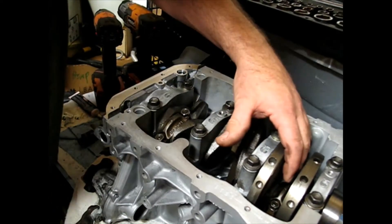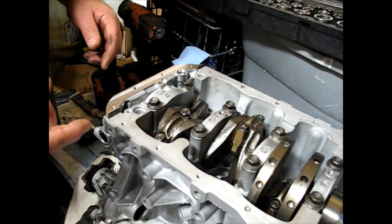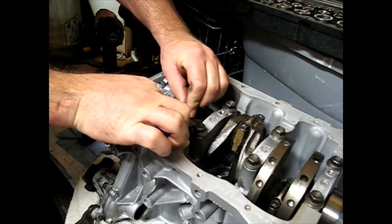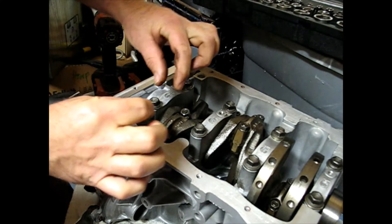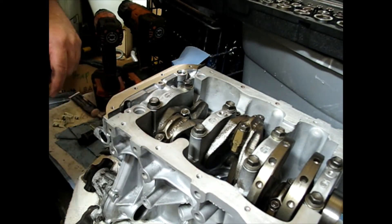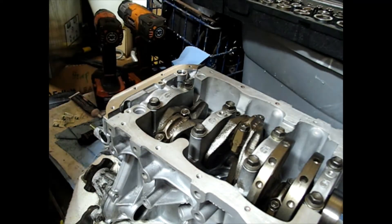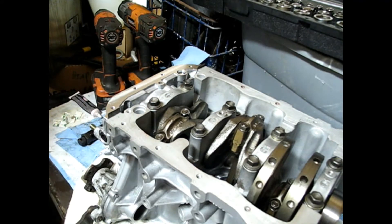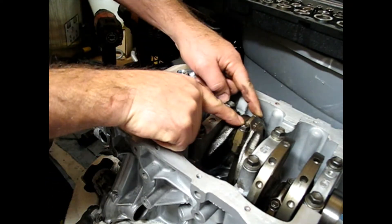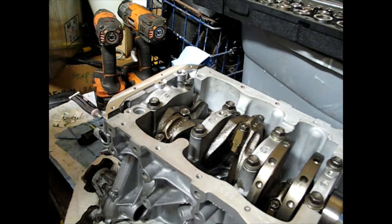Now I've got all three measured and reassembled, lubed up — everything's ready to go. As a double check on the machining, I'm going to take these and actually twist and rotate them a little bit. You should feel them give just a hair. I checked that one already — each one has the same amount and they're all loose in there. Not loose, but there should always be oil clearance, a small amount — nothing should be friction, you should always have a little gap. Check them to make sure they all feel right, just in case something got off-kilter during torqueing.